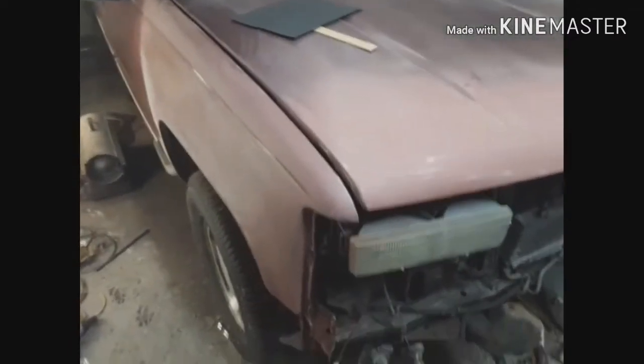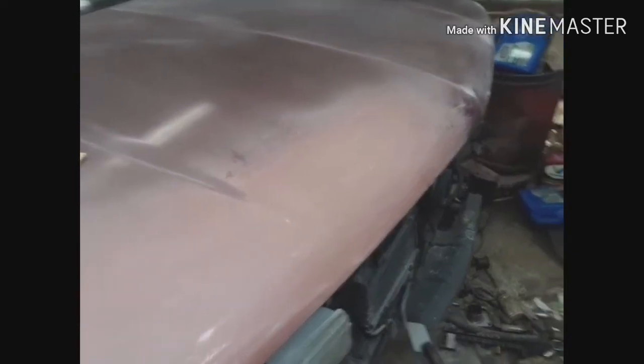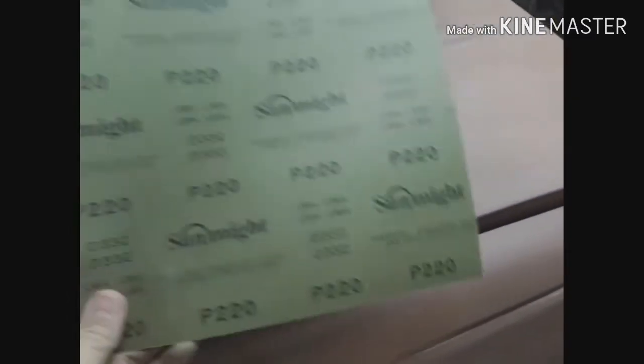So I went over the fender and over the hood with a piece of scotch brite, and on these areas with a piece of 80 grit, knocked down some more of the scratches. I also went all over the clear coat that was peeling — you can't feel that now. So now I'm going to take this piece of 220 and this mixing stick and wet sand the hood and fender.